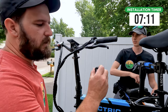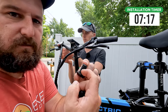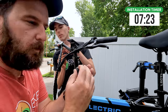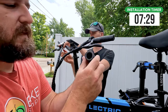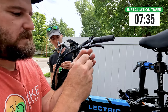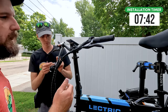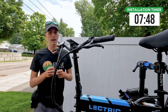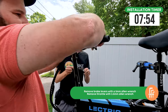Starting out, we're going to start up here in the cockpit. I did already pull out the bar ends so you could see them — if you get behind them and pull, they will come out nicely; they have these kind of teeth that grab. Sometimes these will break off if you don't get them out carefully, but there are two of them. Pull them out from both ends, then take the grip off — the right side shorter grip just slides off. The best way we found is to kind of grab it and use the ergonomic pad to twist it off little by little while pulling out. This is probably the hardest part, as you need to pull the grips off to be able to get the mechanical disc brake levers off.